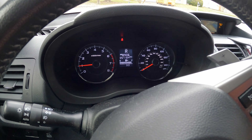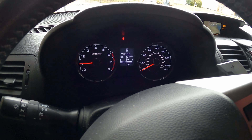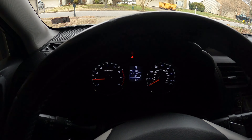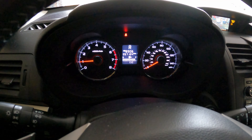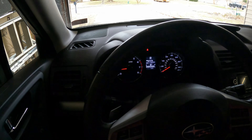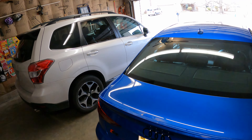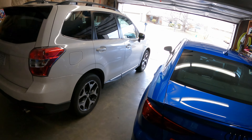It could also be an O2 sensor getting old. We're at 57,000 miles — I'd have no problem just throwing on a couple of O2 sensors to keep this thing running tip-top. Around 60,000 miles I would replace O2 sensors on any car just to get more accurate readings. The code may never come back, or it may return in a day or two. I kind of doubt it's cold-related since we drove in the snow without problems — could just be a coincidence, an O2 sensor voltage low reading.